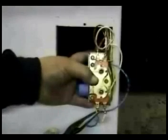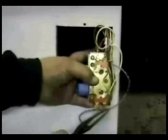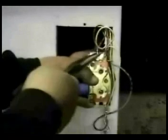Disconnect the washer from the wall outlet. Shut off the water faucets and remove the fill hoses. Remove the water valve assembly. Remove the water mixing valve holding plate. Remove the wires, keeping in mind the location of the wires, blue on the bottom solenoid and orange on the top solenoid.